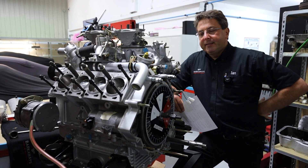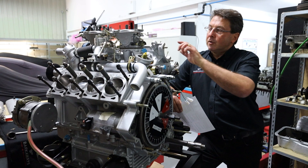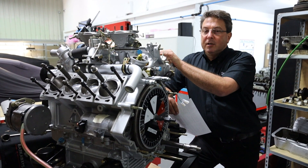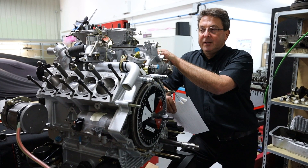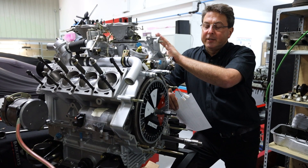This is where it gets a bit more complicated. There are lots of ways of doing this — several ways of measuring it. You can measure when valves open, when valves close, or you can measure maximum lift at top dead centre. So there are various numbers that people measure in different ways.